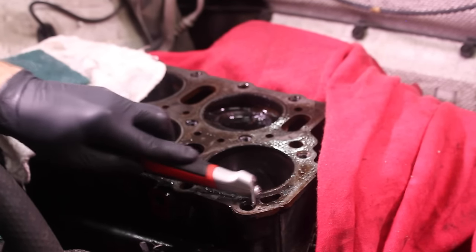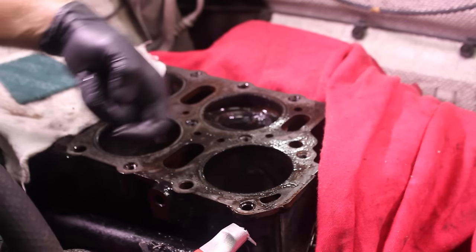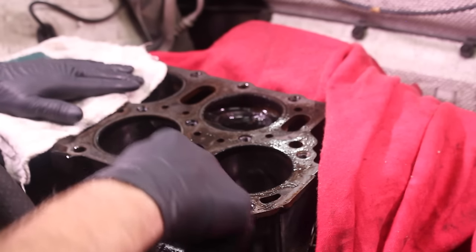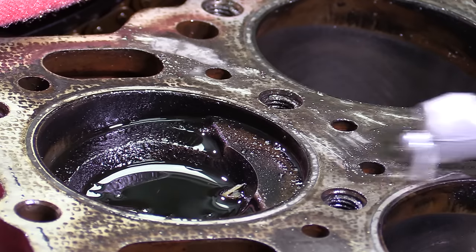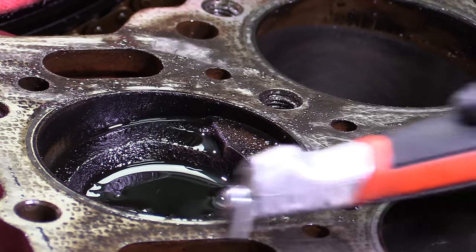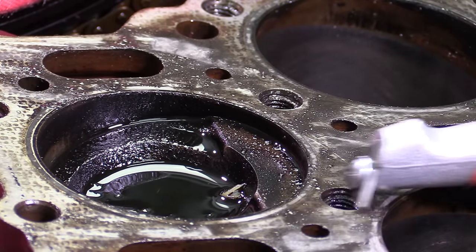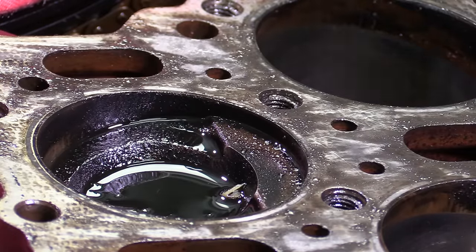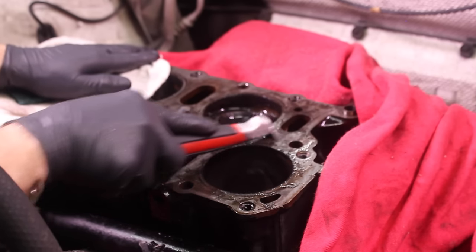If I were doing this at the dealership, I would actually use a roll-lock disc — the green one or the yellow one with the fingers on it — and just hit it with an air-powered whiz wheel, and that would do a really great job of cleaning all this off. Unfortunately at the house my air compressor doesn't really have enough juice to power that, so we're just going to do this one by hand, but as you'll see it doesn't really take much effort or time to get it cleaned. While we want to do a really good job cleaning this for accurate deck measurements, we're not making microchips here. If there's a spot here or there I'm not going to lose any sleep over it — though if you're trying to build a thousand-horsepower car, that might be a time where you really want to send it to the machine shop anyway.